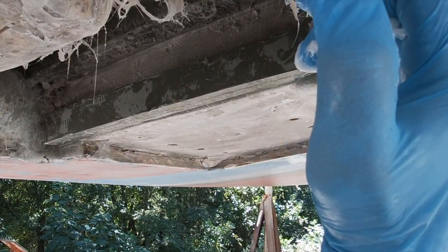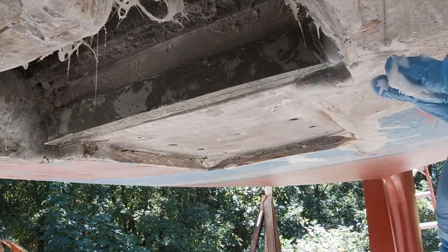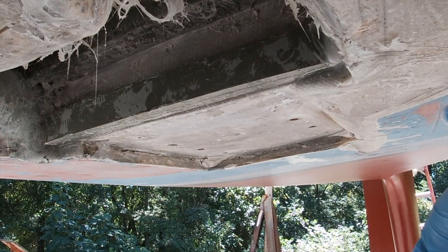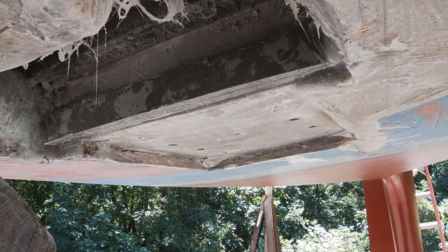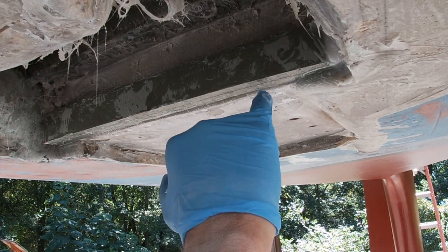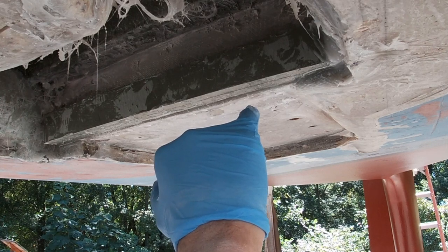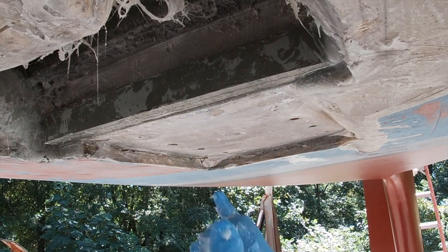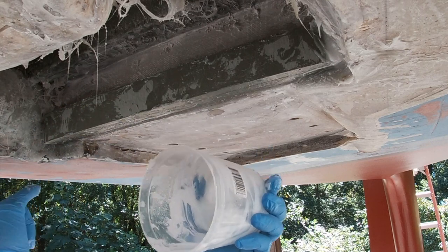All this fiberglass from the skin of the boat's gonna get ground down to a V. So it'll be thin here, thicker here, and then when you lay it, you go one little layer, another little bit layer in, another little bit layer in, and keep doing that over and over again until you build it all back up. So right here, there'll be 5/8 to an inch worth of fiberglass. And then there'll be a lip here, where the strut will come, and that fiberglass skin will drop down and go all the way across and meet up with this.